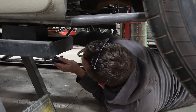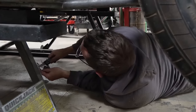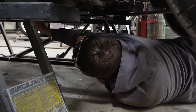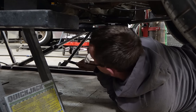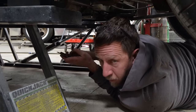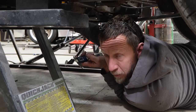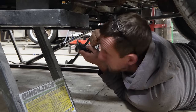2 hours later. The coolant pipes on this car at this end are about 40 millimeters, which is right about what we were figuring for the neck on our electric water pump. Now, interestingly, 6 inches forward of that, it's like 31, 32. So this was a base model Boxster, had a smaller engine, and the coolant pipes were also smaller. But Porsche was thinking ahead, I think, because the very end of it is the same size as their Boxster S coolant tubes. We will be using larger coolant tubes because big engine, we're going to need bigger coolant pipes, for the same reason Porsche did.